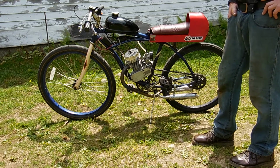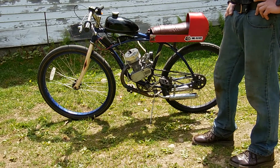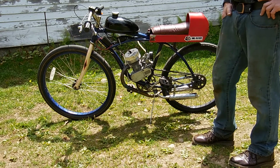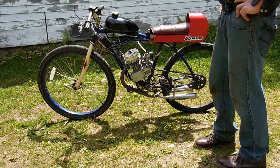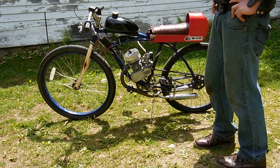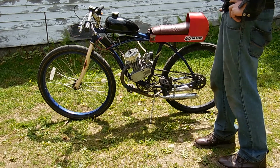Again, it's not a race motor, but for those who need to get to a job, they need something that's dependable. And frankly, traveling over 45 miles an hour all the time can be dangerous, as we now know. So this engine will be available with a few different cylinder head sizes. This particular one is fitted with the 5cc head, and after extended full throttle operation, upon removing the cylinder head, the piston was nice and clean. So that's good.